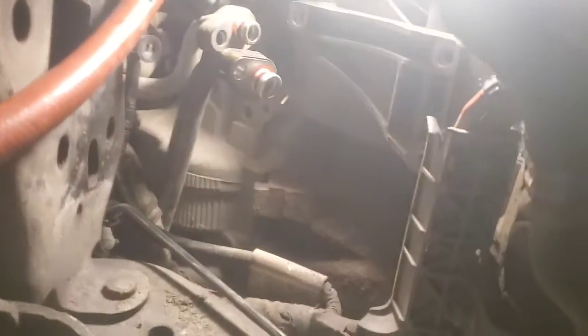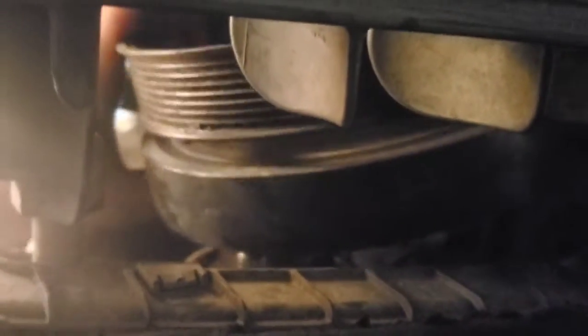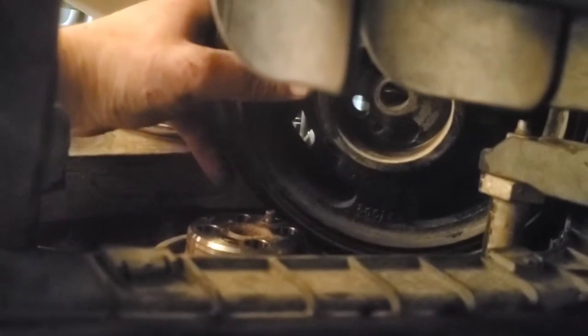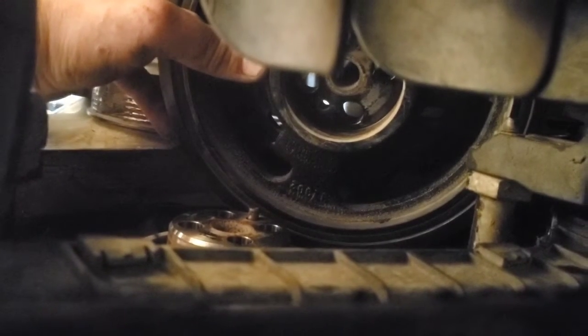In our case, we got in here through the AC compressor side — it lives right up in here — and went in through the side like this. I just used the impact gun to buzz the bolts off and worked off the harmonic balancer. Here it is — you can see the back side of it, and there's that little notch right there between the two bigger holes.